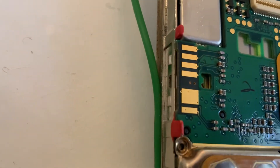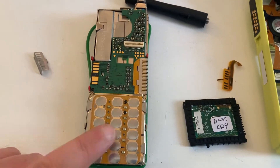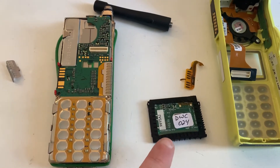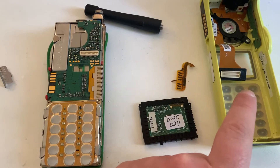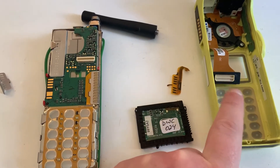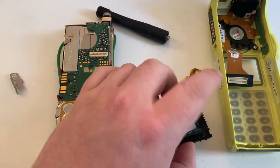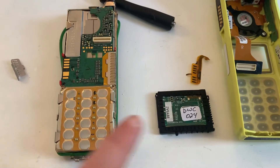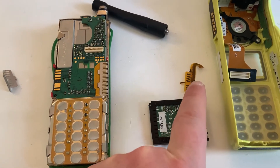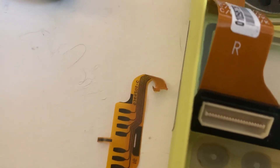The clip just goes on the side on those two little notches there. When I pulled the main radio components out of the case, the screen had a little bit of resistance to it. I think it was still attached to the inside of the radio, just very slightly — not with glue, but maybe just with suction caused by the rubber casing. As I pulled this out, the very fragile flex snapped. You can see it's completely sheared off now.